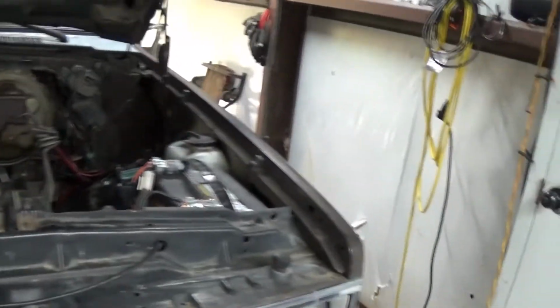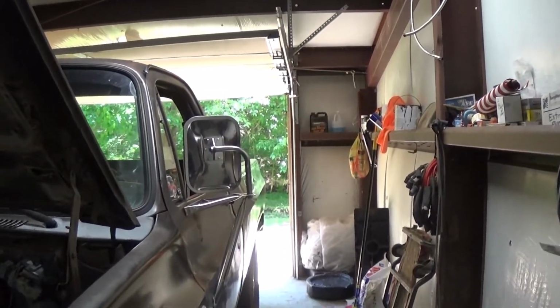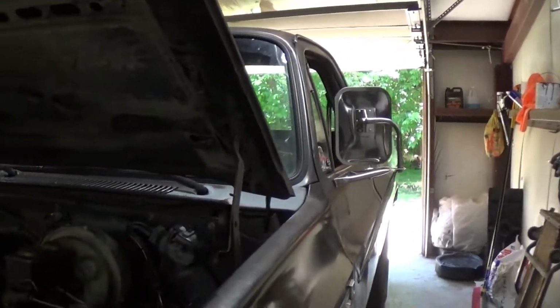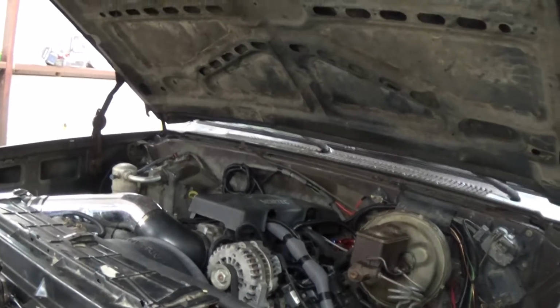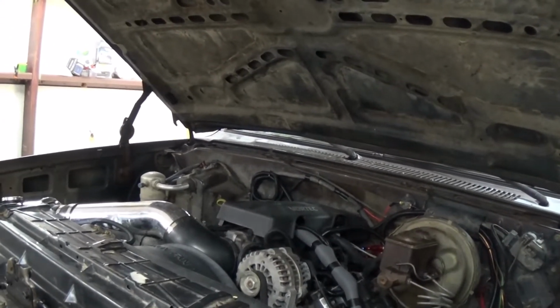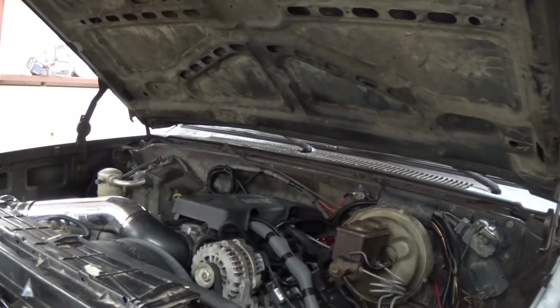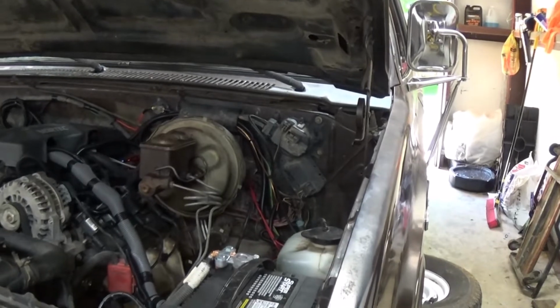But it's running really good. All the smoke has gone away. It runs good and clean now. It was smoking a little bit when I first started it, but that's just normal for engines sat around a bit. And the lifter noise is starting to go away too. It's still present at idle, but it is a lot better than it was. So getting the bugs worked out.